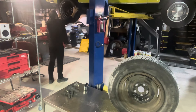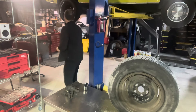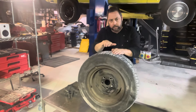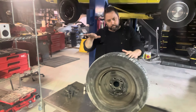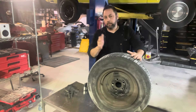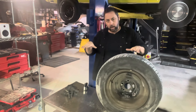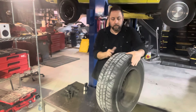How much does the extra air weigh? It looks great up there, doesn't it? The tire being 5% larger means it's also a little taller — just a little over half an inch taller, so the center is only a quarter of an inch higher. It will give a little bit more ground clearance — the car will ride a quarter of an inch higher than before. If you really like your car's height and profile, you may not want to mess with anything taller and might just want to try to get a little wider.